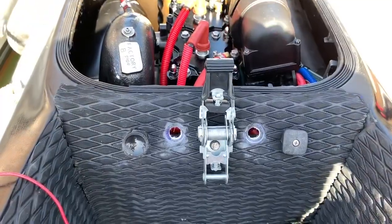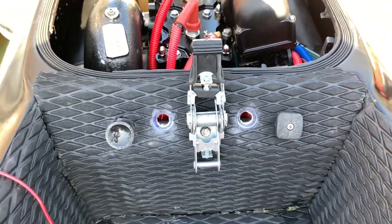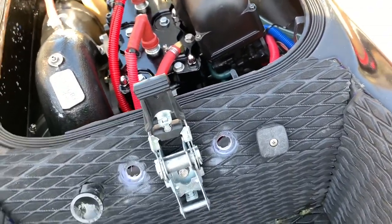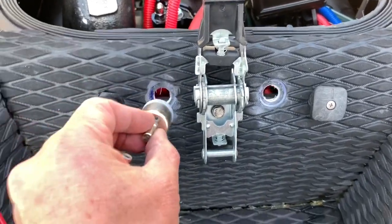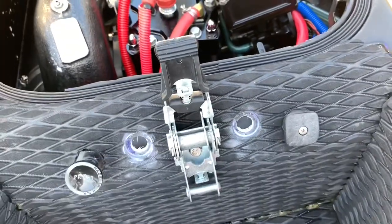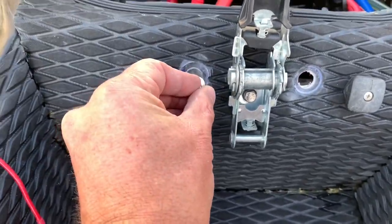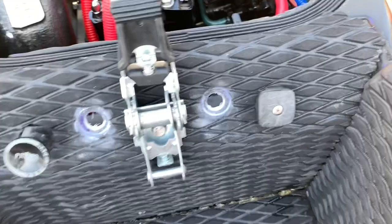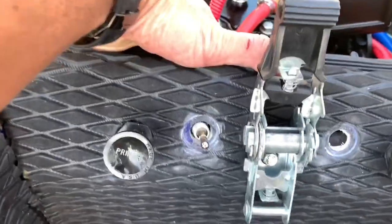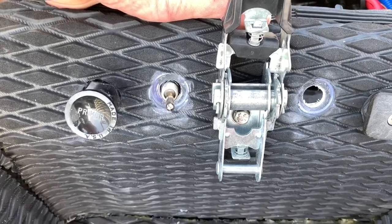I decided to keep the primer and instead install a second hole so it's more symmetric — I think it looks better. I used a 26mm diamond hole saw for the bigger cut first, then a 16mm for the smaller hole. There's a decent amount of space — probably could have gotten a little tighter — but the switch goes in there nicely. I'll probably put a little silicone in there, and there's enough room for the washer and everything.